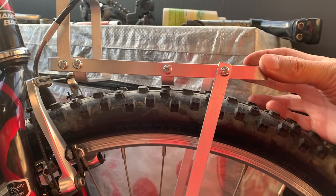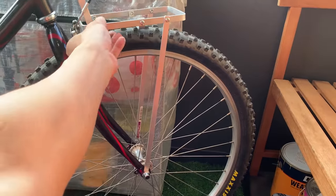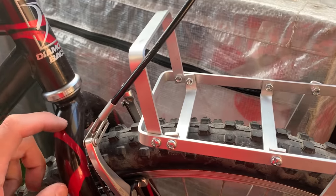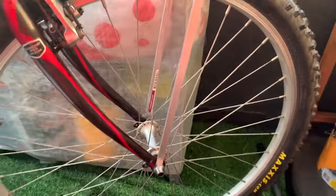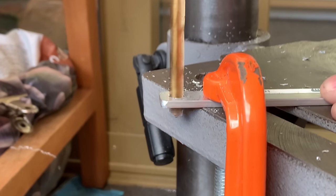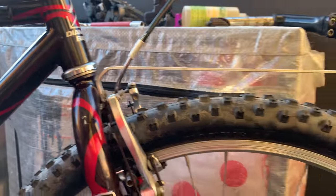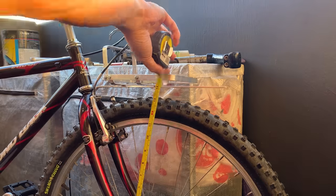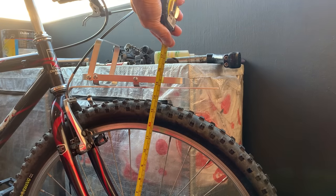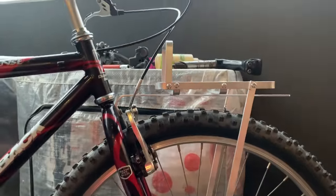I chucked it on the bike and it was too low. I didn't measure it high enough — I didn't account for the braces being a little lower. I tried mounting it to the quick-release axle to see if it pushed it up any higher, but no. So I decided to make the cross brace first to see how far to push the rack up before cutting the struts again. The cross brace needed to be drilled to M6, a little bit larger. A few bends later I got the cross brace on, slipped the rack on, and measured — the struts ended up being about 400 millimeters. I then redid the struts, drilled and rounded the corners, and now it's looking pretty good.